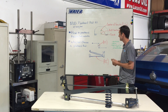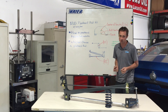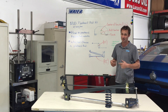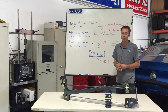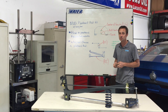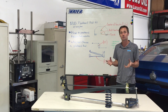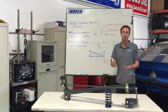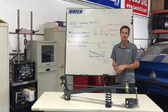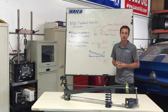The next thing is simplicity. If we're going to sell this to people who just want a car that handles better and works really well — and in our shop, we've got money to spend across the whole car, not just one component — it's cheaper for us to manufacture a really good Panhard bar than to do a really wonderful Watts link. That means we can sell you a component that's palatable financially, it works really well, gets our roll center down where we want it, and we can install it fairly simply and have a really great handling car.